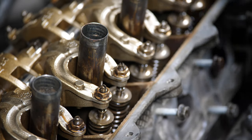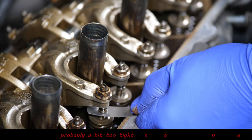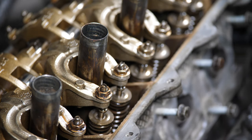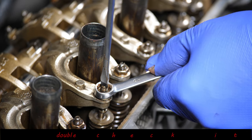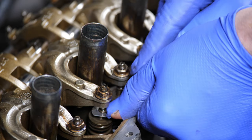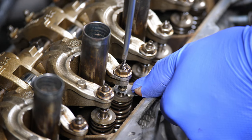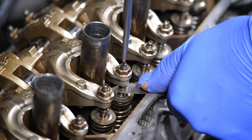Just pinch — if you keep rotating you'll actually push the valve open, so you're looking for a drag and certainly not pushing the valve open. Once that's right just pinch that back up with the 10mm spanner and then double check it — pop your feeler gauge under there. It's got a nice little bit of drag there, probably a little bit too tight. There we go, that seems to be right. Then we've got to do the same again on the second inlet valve because obviously there's two valves per cylinder.